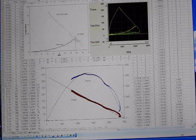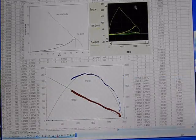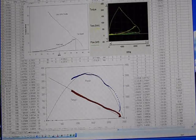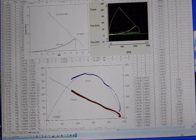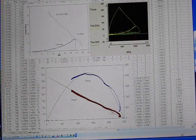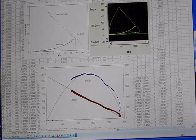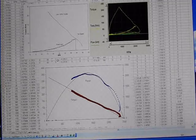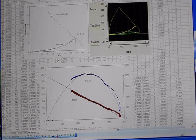More complex analyses are also possible using simple software like Excel. Here's the wide-open throttle torque curve of the motorcycle as well as a road load curve — where the two lines intersect indicates the top speed of the vehicle on the road. On the right we see a screenshot taken from the dyno logging program during testing. Finally, in the bottom graph we can see a theoretical torque and power curve from an electric motorcycle. The actual data follows very closely the theoretical torque and power trends, as it should be. Complex analyses like this are actually fairly simple with this hyper mileage dynamometer program. For more information, a manual, product information, or a quote, please visit our website.